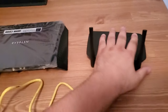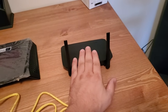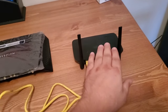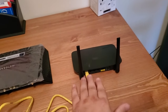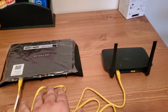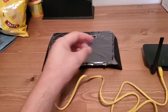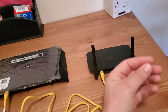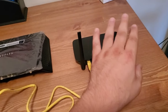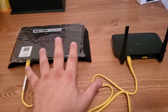I also want to point out: if you disable DHCP on your second router, it doesn't mean devices connected to it can't get an IP address. Once you connect a device to this router's Wi-Fi or wired port, your device says 'Hey, I need an IP address.' Since it's all on the same network, that request travels over the cable to the main router, which says 'I'm a DHCP server — here's an IP address.' It sends it back through and assigns it to your device.